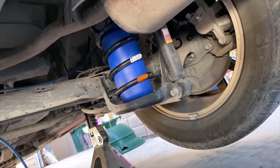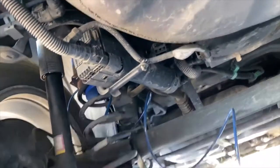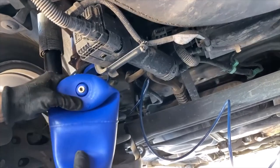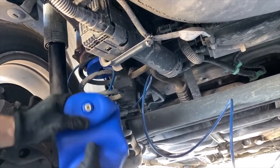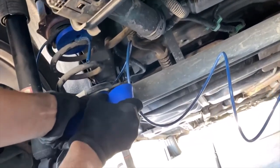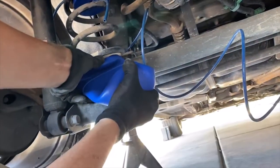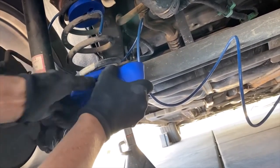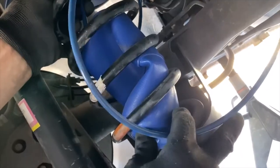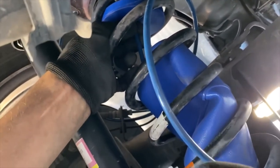The airbag faces up — the nipple on the airbag faces up. We're putting this one in now. You have to collapse the bag completely, and it works better with two people. You can see the hose is coming down with a donut up there to protect the connector. We're putting the bag in through the bottom of the coil spring, going through the first rung of the coil. It's partially in and we're going to put the hose onto the nipple while we still have room.